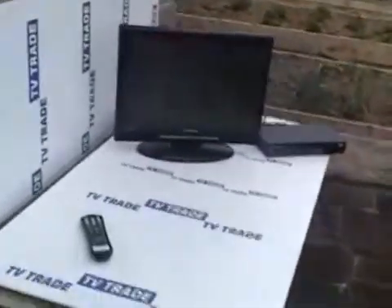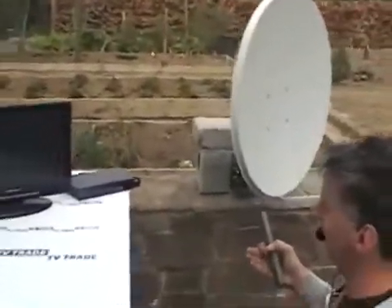After exiting the menu, pressing OK brings up the channel list. We can see BBC channels at the top coming in on the Astra 2 satellite, and scrolling to the end of the list we can see Astra 1 channels — both working automatically. Full scans on both satellites would tune in everything. Simply using the remote control, you can flick between the two. From my experience, if the satellite box has been programmed before setting this up, it won't work — you must tell it which input and satellite feed to expect. That's it from beginning to end: how to install a two-way DiSEqC switch on a Triax SR110, which is basically the same format for any DiSEqC-enabled box.